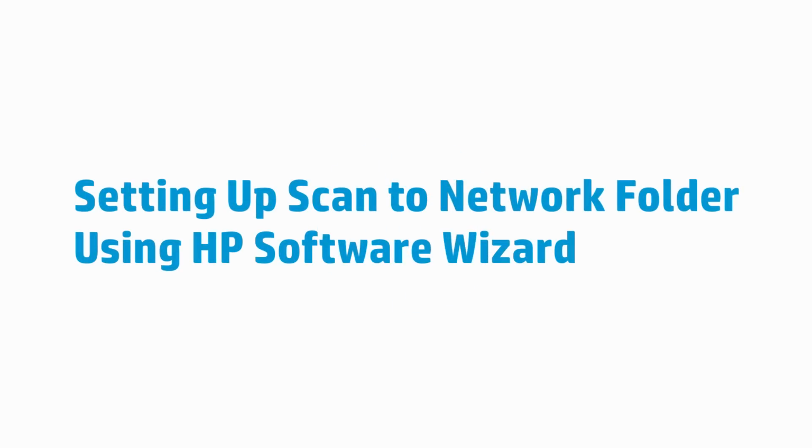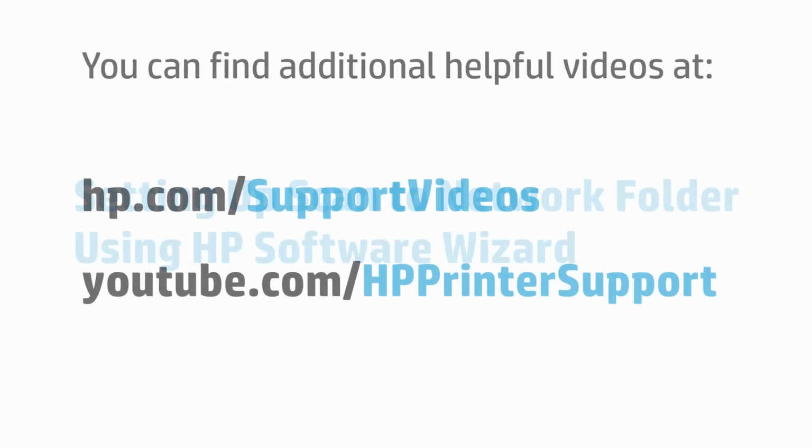This video shows how to set up and use the Scan to Network folder feature on an HP LaserJet Pro MFP printer using HP's Software Wizard in Windows. These instructions apply to all LaserJet Pro MFPs, but the steps might vary slightly depending on the model.